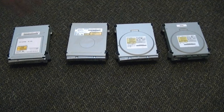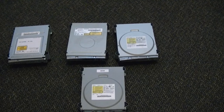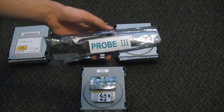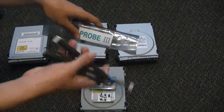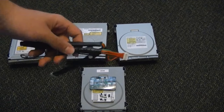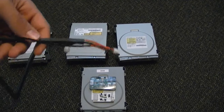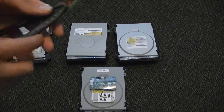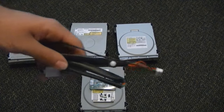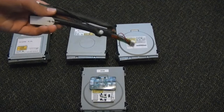Now, out of all these drives, the LiteOn is going to be the hardest drive to hack. For this one, you're going to need some data, some power, but you're also going to need one more thing to retrieve your drive key — you're going to need a probe. There are several variants of the probe. You can buy the Probe 3, and all of the stuff I'm showing you can be bought off XConsoles or modchipcentral.com. It is a really big power cable, with an inline power button to cut off the power quickly when pulling the drive key off, and an actual probe on here. You can make one on your own or buy one for about $12 to $15 including shipping.